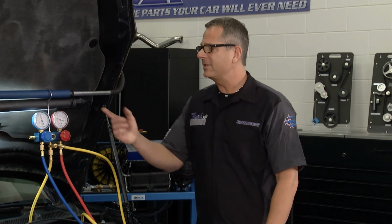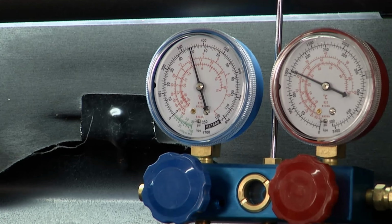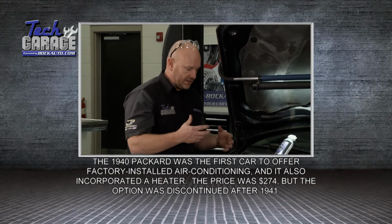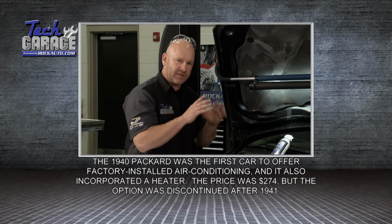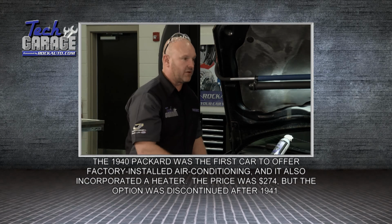So what's the deal is that should drop just a little bit because you froze the top of that TXV. When you do that, bam, it should go closed. If it's going closed, that compressor should pull that into a vacuum. So I'm suspecting a bad TXV valve. Yeah, that's the one place in the system that there could be some kind of restriction, some kind of bottleneck. And interestingly, John didn't complain of a belt squeal or any strange sounds from the compressor when he turned it on to max AC. So even though the gauge readings could point to a compressor, it doesn't really look like it at this point, but we need to go ahead and prove that.